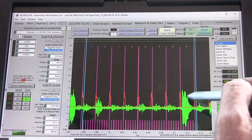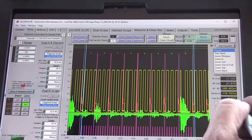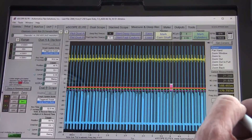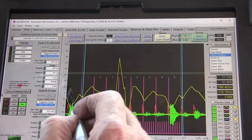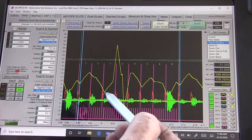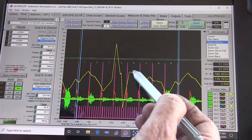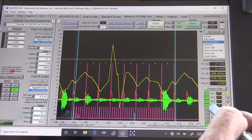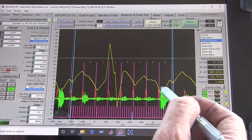So number eight injector is the one that's leaking and that's what's causing the problem. Now I want to take this cam and modify that waveform, turn these off so we just have one, and mark this, then bring this down. Get the zoom window right in where we were just looking. We can see that one fired — do you see how one sped up and then slowed down? Then it slowed way down and two missed. Seven fired — do you see how the crank started to go faster? Now four fired — do you see how it went faster and it came down? Five fired. Six didn't fire. Now eight fired — do you see how eight came up? But eight has a problem there. Eight sort of slowed down because of the leak.